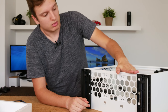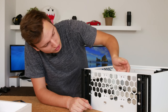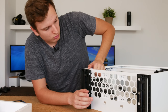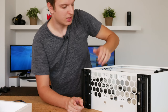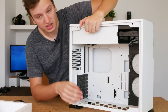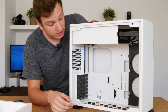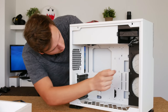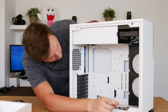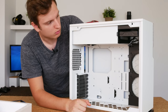Only one 120mm fan support, which is a bit of a downside, and they're also not on sliders. The holes are a bit elliptical, but you're probably going to have to drill if you need 140mm fans or if you're using particularly old radiators. You should be able to fit up to a 360mm radiator in the bottom here, which is great, but you might need to drill if you're using the 120mm hole spacing radiators from a few years back. This bit for your AIO cooler is actually plastic, so hopefully I can just remove it completely and put intake fans in the bottom instead.